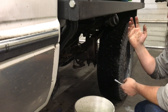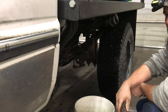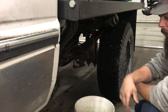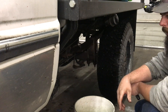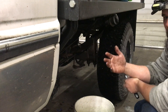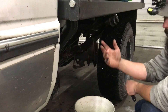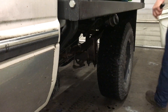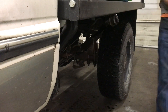One difference on this truck: I probably won't be draining the slingshot filters as often as the Toyota. I might end up needing to, but they sit over the top of the frame rail, so if I pull those caps off they're going to make a giant mess, and I don't want to do that in the shop in the morning. My normal routine is to pull whichever wood burner I'm driving — whether it's the Dodge or the Toyota — and drain all of my condensates every day. That has a lot to do with the weather where I live — Pacific Northwest, it's always wet and rainy.